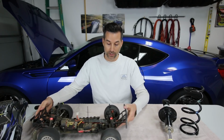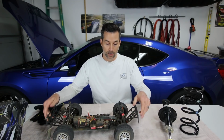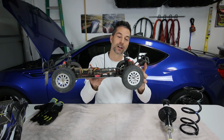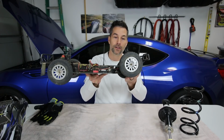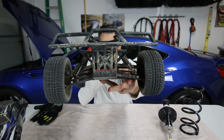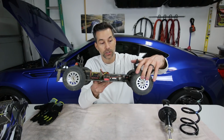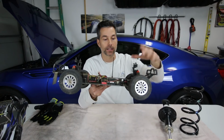Now, picture your car or your truck or whatever it is rolling down the road like this one is here. When you hit a bump in the road, your tire compresses, or the suspension, I should say, compresses. The shock absorber on the front here, as the tire hits the bump, it goes up in the air. And we'll see if we can get a better view here. So basically the action of that shock absorber going up or compressing, we're compressing the shock together,